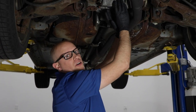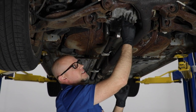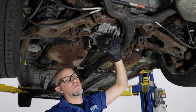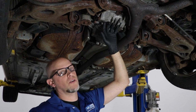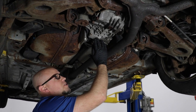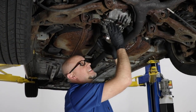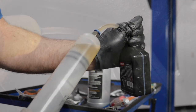Now we want to check the fluid levels, starting with the rear differential fluid level. Pull this fill plug out and check where the level is. If the fluid is low, top it off. If the fluid level is fine, put it back and move ahead. If oil — gear oil — comes out, most likely there's a bad seal between the clutch area and the rear differential, and fluid has pushed its way through that seal into the rear differential. In our case, that's exactly what happened, so we drained the fluid, put the drain plug back in, and put fresh fluid in.